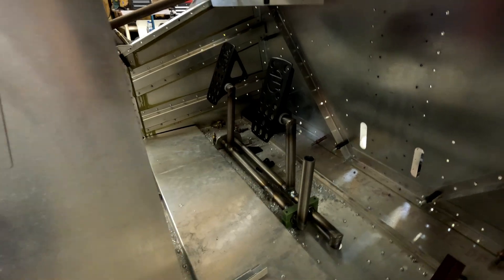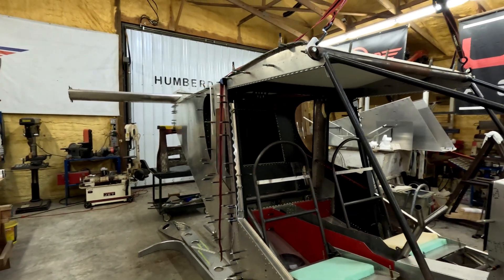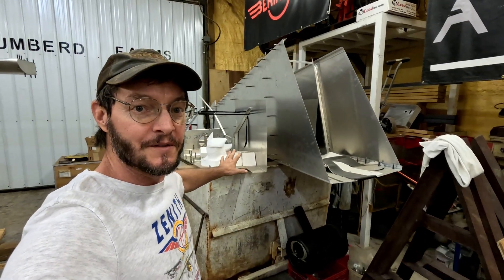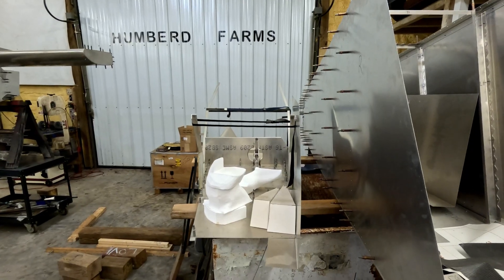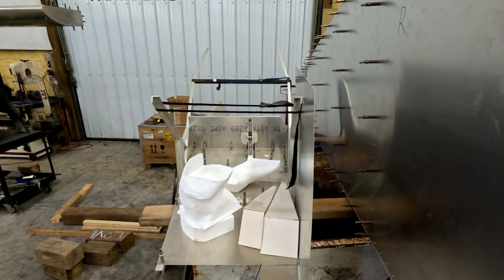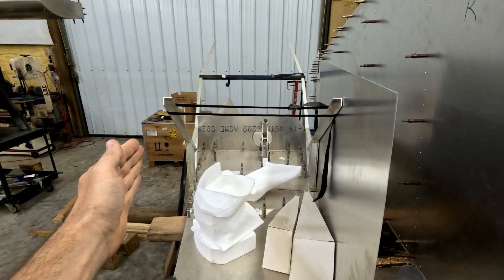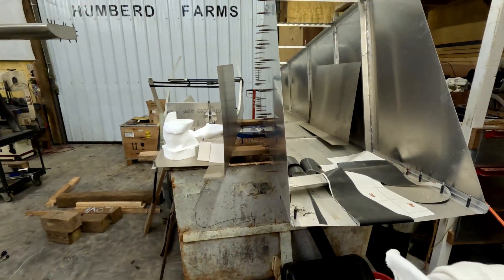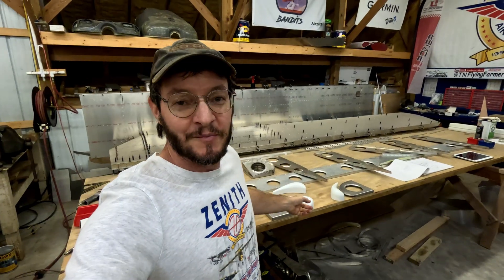The brake pedals under there are all titanium. I've got a lot of titanium stuff in the works and it's pretty extreme — the 'super duty extreme' is what I'm calling it. Custom engine mount, custom a lot of things. But I really want to get back to this single seat and start pursuing it some more while I'm waiting on parts. The basic single seat layout — looking at it from the front, I've essentially eliminated the whole left side into the center tunnel, so all you have is just the right seat. I've narrowed down the rear fuselage to match what the single seat Zenith 701 would be.